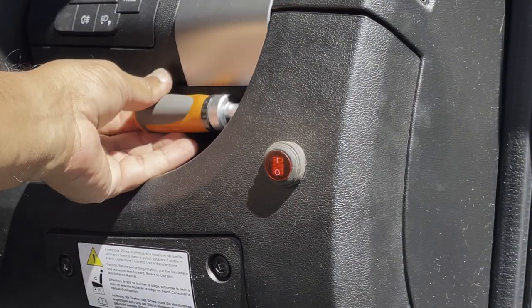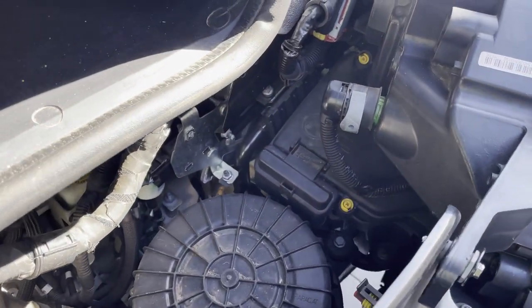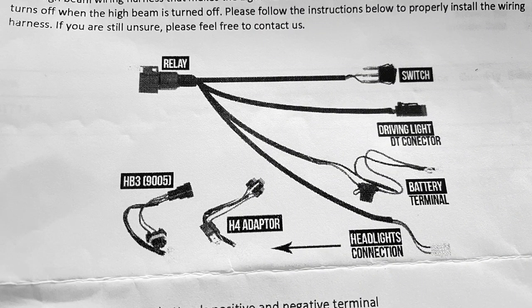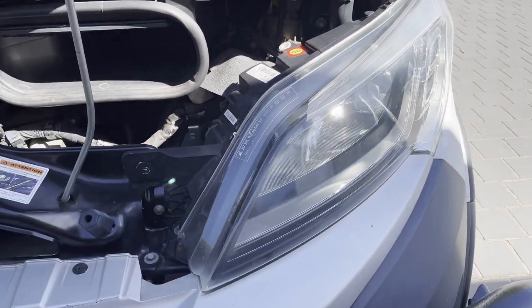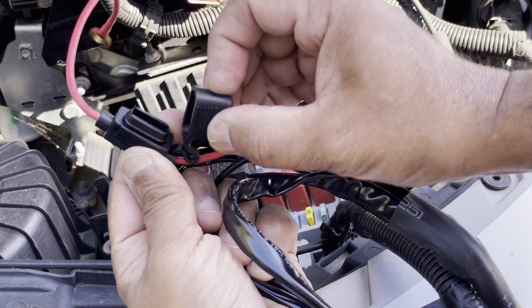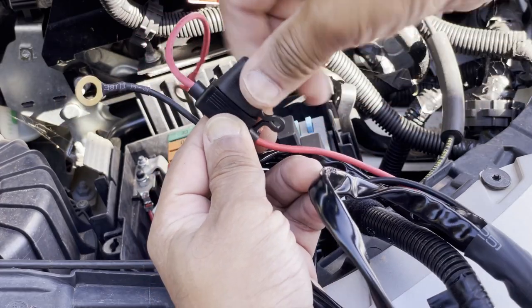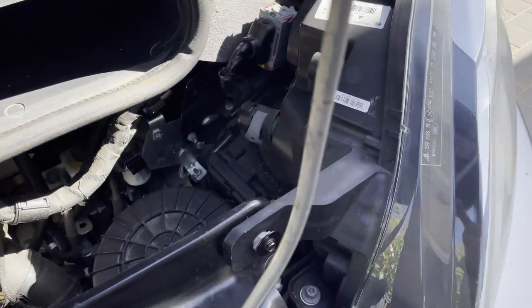The final step was the installation of the switch inside the cabin — that's the switch for you to turn on and off the accessory light. Let's start with step one, which is to connect the red and black cables. Forget the instructions; they're very confusing. It's actually very simple, and you're going to be much better off ignoring them. The first thing you want to do is disconnect the fuse of the LED accessory light. This will make it very unlikely for you to cause unexpected shorts.